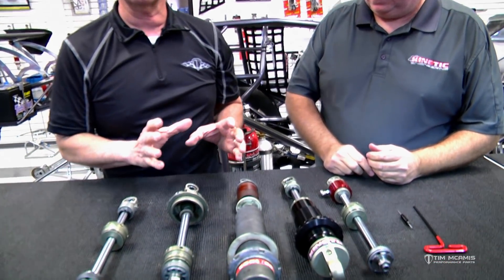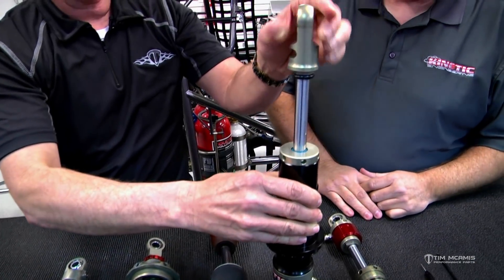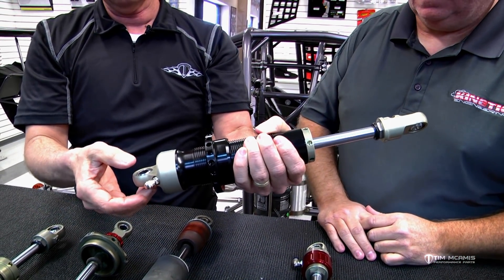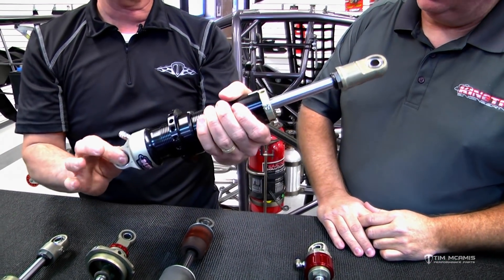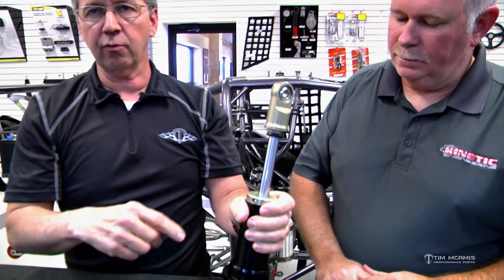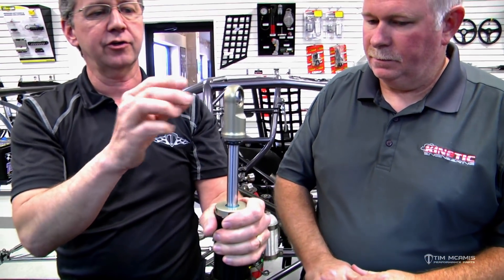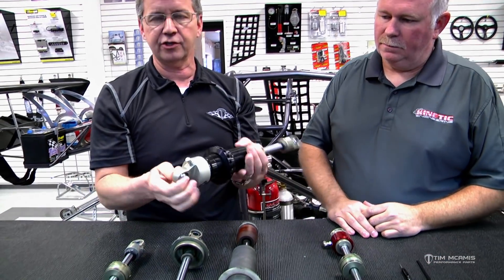One thing to talk about when you change from one shock to another: you have to make sure you're mounting it properly. Not all shocks have the exact same width bushings. These have a half-inch hole in them, and depending on your mounting hardware, you may have a bushing that goes in here to reduce the hole, or offset spacers on each side to keep this centered up in the bracket. Don't just take it for granted that the shock will swap out — you might take the old one off with a bushing pressed in and put a new one on with a three-eighths bolt in a half-inch hole. Make sure the hardware is a nice fit into the center, and the shock needs to have bushings on each side to keep it centered in the bracket. We're going to wrap up this segment — thanks for watching and stay tuned for the next episode where we get into more detail.